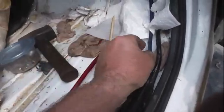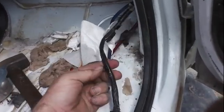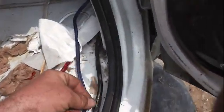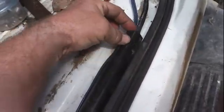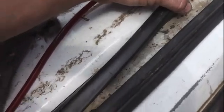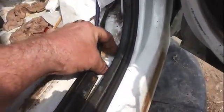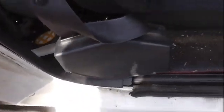These wires — this is a power wire for an amp and that's an RCA. If you pull yours up, you're going to have this. That looks stock — power lines that are run to the back for stuff. There's also plastic sheathing on there as well. If you're already flooded, make sure you lift up the sheathing and dry underneath it, because it's very possible that's where water pools. But this entire channel could be all messed up going to the back seat and flooding under there too.